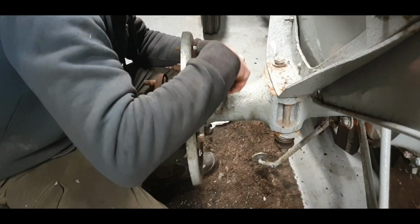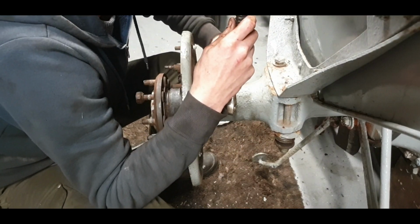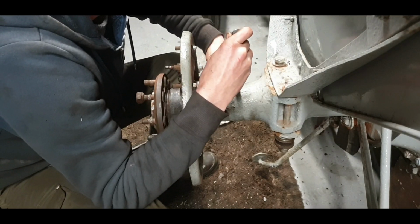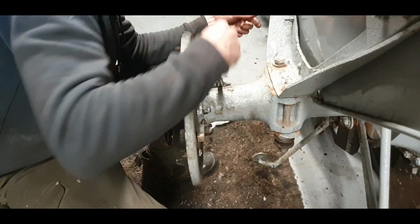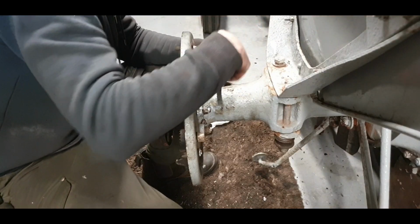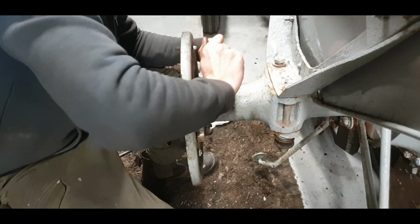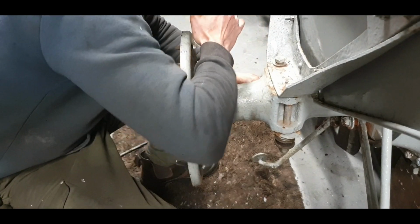But when you only put three of them in, you are increasing the chance that it could tighten in a bit more and then you have to pull a whole lot apart. That's what I was watching for. Sometimes, I remember trying to fine tune it, I threw in all six. This was very well shimmed, it's just when you take out them gaskets and they rip and you clean them out with your wire brush and your drill, you've no choice to do that anyway. If you don't go replacing them gaskets, just put in the shim.